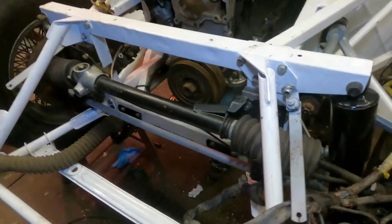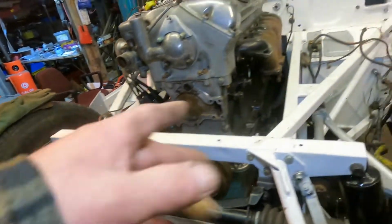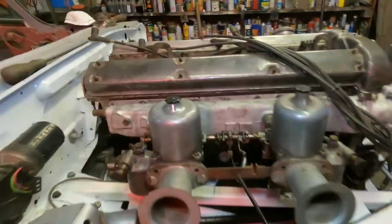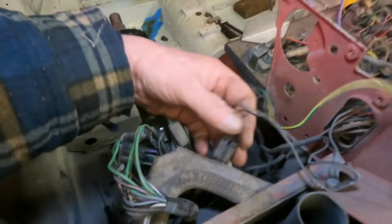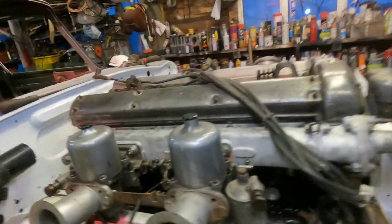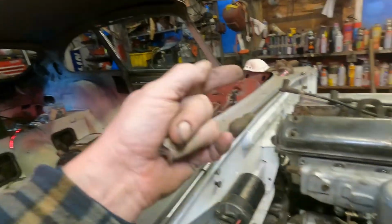My main aim is to get a water pump in there. Once I get a water pump in there, I can then do the alternator pulley and sort this out. I'll do this tonight and get it cranking over. We're going to go with the smooth rocker covers, much to my disgust. We're actually going to go for a remote tacho drive. If there's a drive there, I'm going to put a tacho in there, because this one here will not work with electronic ignition, so it may not be needed. I may well rewire the ignition side of it, just so that I've got a remote tacho working on a 4.2 rev counter. And that'll be fine.